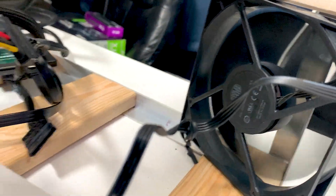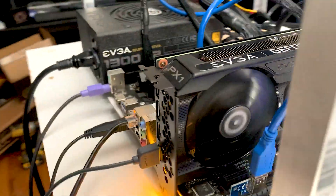I added a fan just for some cooling to keep this GPU cool, as it is running a little hotter than my other ones. You also have to have it plugged into either a monitor or have a dummy plug into it — I did order some dummy HDMI plugs. It needs to have a signal coming out of the GPU for it to work. I have seen in other places that people have gotten two to work, but right now I only had one thing to plug it into.